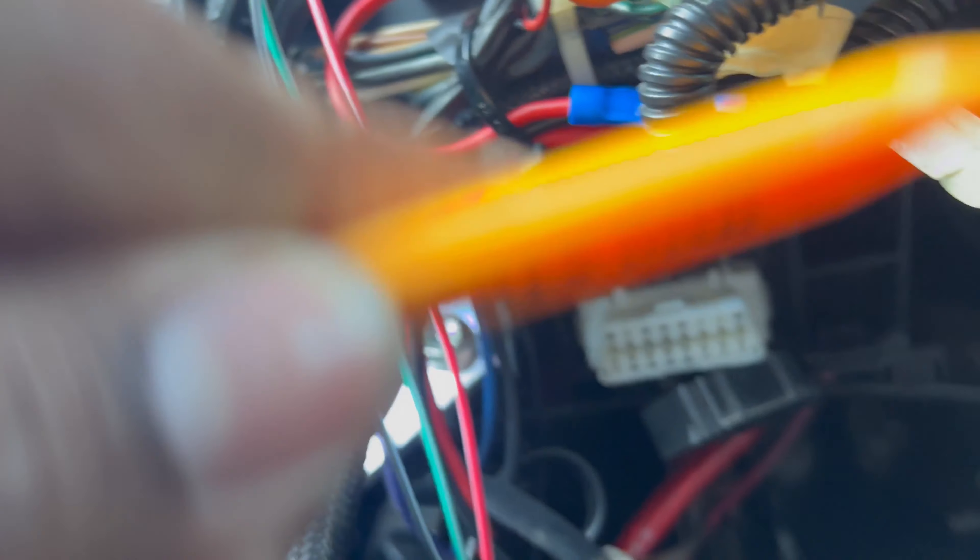For the programming portion, hold this button as you plug in the 20-pin connector — the one that goes up top. As you're plugging it in you should see a red light flash; once it flashes, let go of the button. Then plug in the rest of your connections: the ignition connection goes up here, the antenna connection is down here, and this connection goes to your OBD-2 port. After the light stops flashing, turn the key on. If your vehicle is not equipped with an immobilizer, hold this button again until the lights flash red and green, then proceed with the instructions.